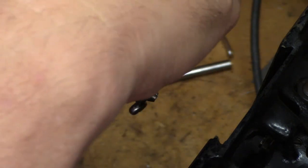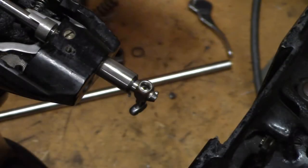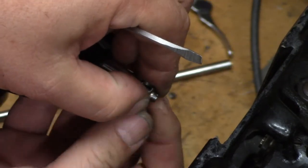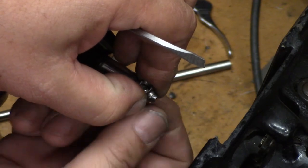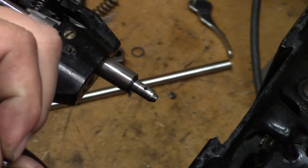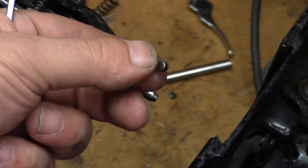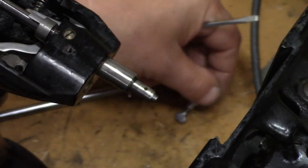That can make this a little tricky. So very carefully start by removing the set screw, setting it aside, and keeping a hand underneath it if you're going to do it in this orientation. Pull the screw out a little bit — it's still not ready to come — and it will eventually come off. You'll see that there's actually another little piece in here, which fits inside the needle clamp. Set that aside.